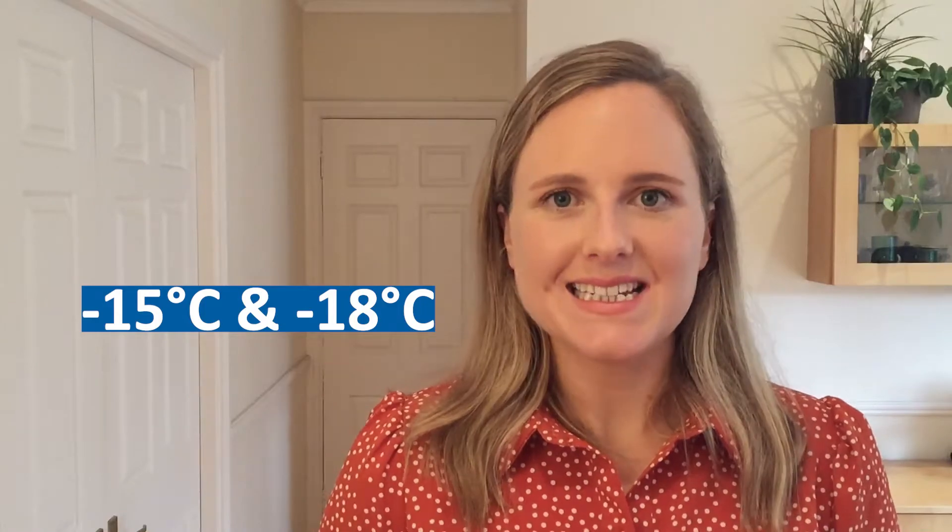The final tool in the kit is the fridge freezer thermometer. This is a great tool to check if your fridge and freezer are at the most efficient temperature setting, because if they're too cold you may be wasting energy. All you need to do is place the thermometer into your fridge for about 30 minutes to make sure it's at the most efficient temperature, which is between three to five degrees Celsius. If it's colder or warmer than this, simply adjust the temperature on the dial inside the fridge. Similarly, if your freezer has a temperature dial, place it into the freezer for 30 minutes and make sure it's between minus 15 and minus 18 degrees Celsius.